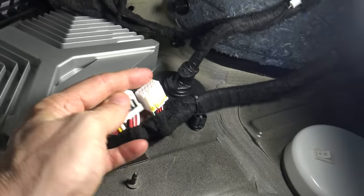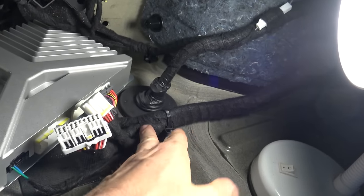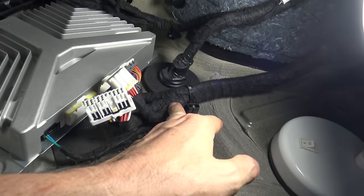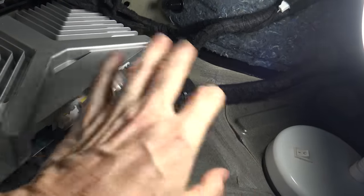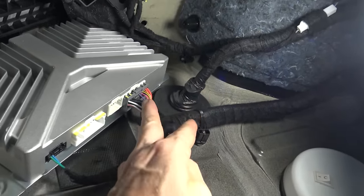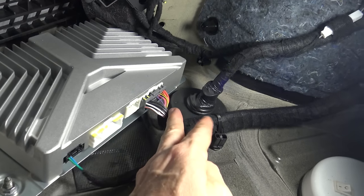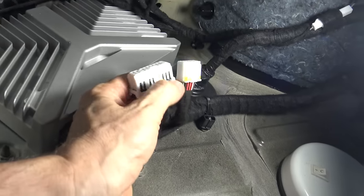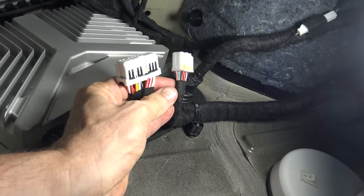The reason I needed to find these pinouts is because I'm going to take a high-level output from this. I'm going to cut these cables and feed them into the high-level input of my signal source, and then my own amplifiers are going to go out to the speakers. There's also these other connectors which I haven't pinned out yet - that'll be like the center speaker and the other things up the front. I'm not terribly concerned about them at the moment, this was my main thing I needed to get going.